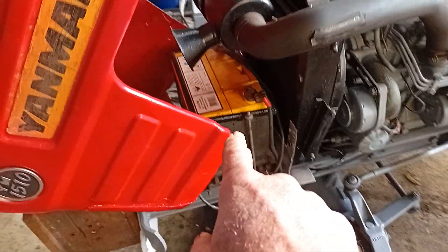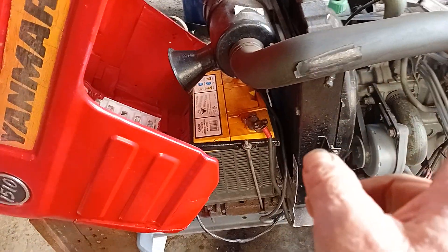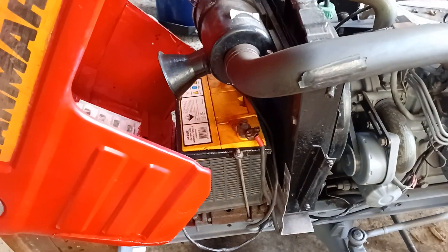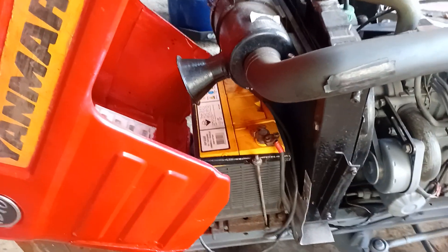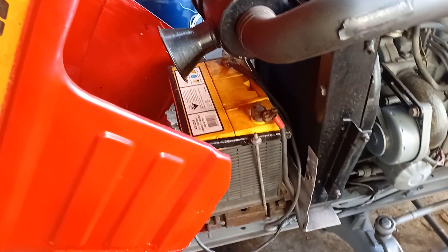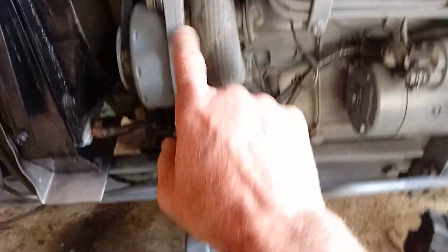Come over to your battery and check with the engine running. If you're getting up to 14.2 volts, you're good. If you're going over 14.2 — like 15 or 16 volts — that means your regulator is stuck on. On the other hand, if you're sitting at around 12.2 volts — the same voltage as when the engine is off — and you start the engine and the voltage doesn't go up, that's a problem.